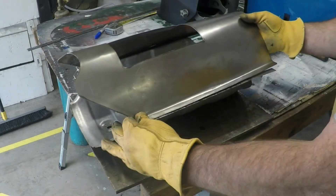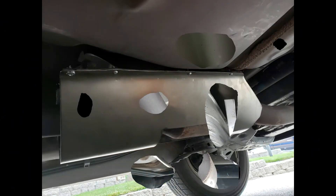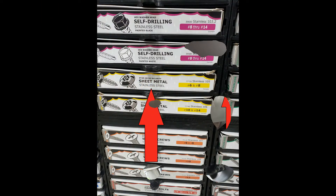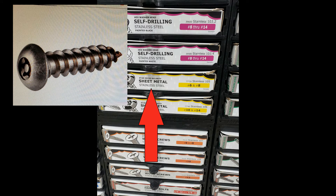It looks like we're ready to start doing some assembly. Reinstall the heat shield back onto the car. Now you can attach your protective shield to the heat shield using screws down both sides. At first, I just used standard sheet metal screws, because I wanted to drive the vehicle for a couple of months and see if the steel heating up and cooling down would cause the screws to back out. It did not. So now there are a couple of options you can go with here — leave these screws in, which is not an option I prefer to take.